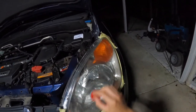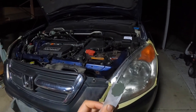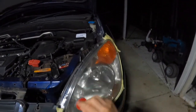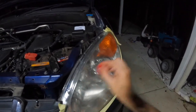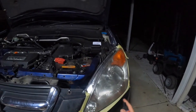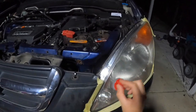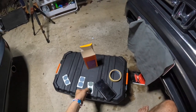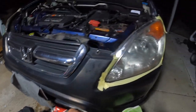Just go along and kind of polish it on — all the grit. You can actually see all the grit and crud that it's taking off the headlight. It's pretty much like clay barring your headlight, or wet sanding in a way, and then we're going to go along and polish it out afterwards. After a couple of passes, spray a bit more lubricant on, go around the bottom. After a few passes, once you can feel some grit has come off, take that pad off, put one of the round pads on and repeat the process again.